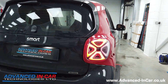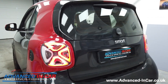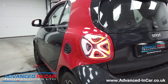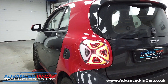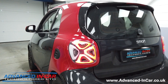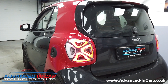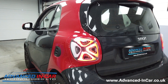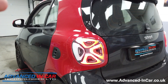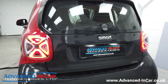So — 2017 Smart 453 — we've installed the newer style facelifted rear lights. These are the only ones available at the moment because it's an all-integrated unit. You can buy the kit from us, or buy and have us supply and fit it at our workshop in Poole. Bear in mind if you buy it as a supply-only kit, you will have to do the coding, otherwise you'll get rapid flashing on both the external indicator and the internal arrows.